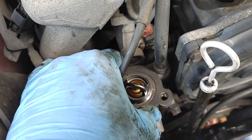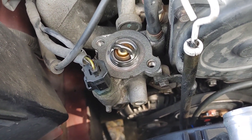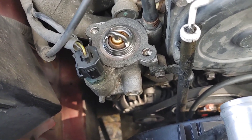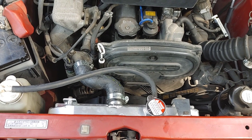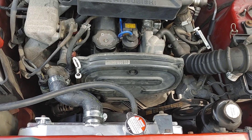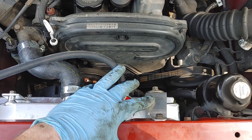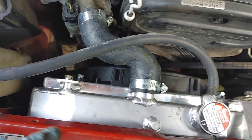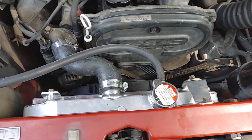What's nice is it can be had at a local parts store for $5. It'll be any Geo Metro or Suzuki Swift — this one specifically was a 91 one-liter three-cylinder Geo Metro. So here it is all bolted in. If you want to keep it cheap and you've got some tools — drill bits, saws, whatever — you can get some aluminum flat stock and make these mounts. I bought an upper radiator mount for the same Honda Civic. I ordered two but only one came in. You see the line-up with the old shroud or radiator bolts. Get a pair of those and a fender washer, and you bolt it to where the shroud mounts.